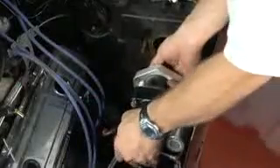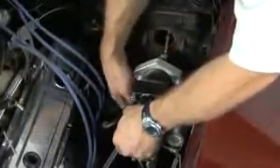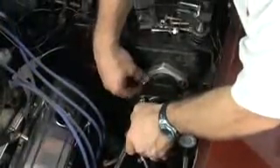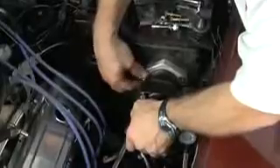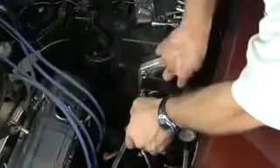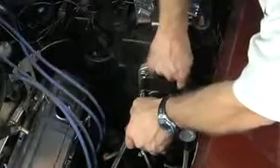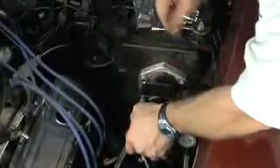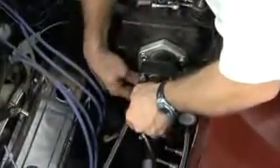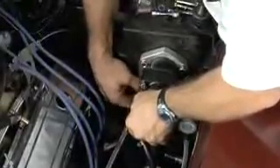We're going to go ahead and slide the assembly in. We're going to reuse the original bolts that come out of the firewall — the kit comes with new hardware to attach to those bolts. I've set all this in finger tight for the moment. These are the original bolts your non-power master cylinder was connected to, and we'll assemble the new grade 8 bolts into the same holes where the original bolts came out of the firewall. We're going to go ahead and tighten this down.